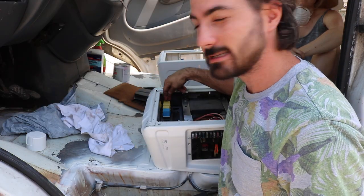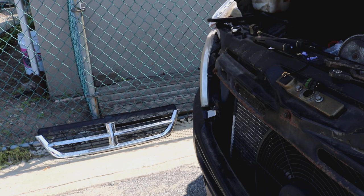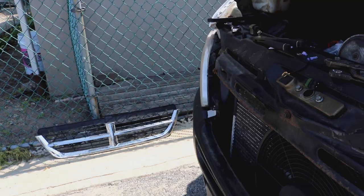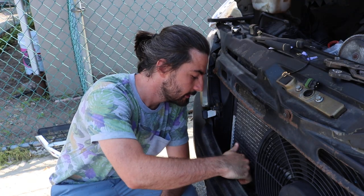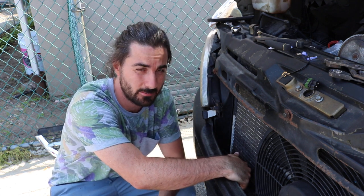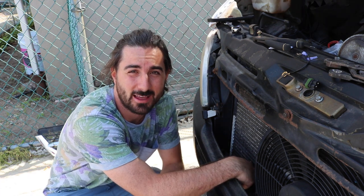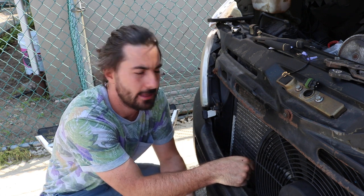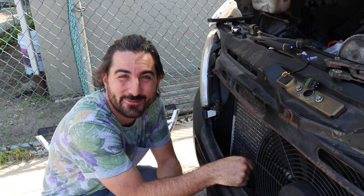After that I installed the fuse back in, turned the ignition on, and tested the horn — and as you guys can tell it beeped! We tested the horn, it works. Now we're just gonna finish by tightening everything up, and that's it — that's how you change a horn on a 2003 Sprinter. If you guys enjoyed, make sure you like, comment, and subscribe to the channel. We're gonna be doing more van build stuff, as well as all the activities I enjoy. Hope you guys come and hang out — see you soon!